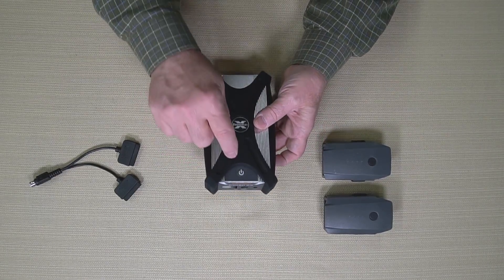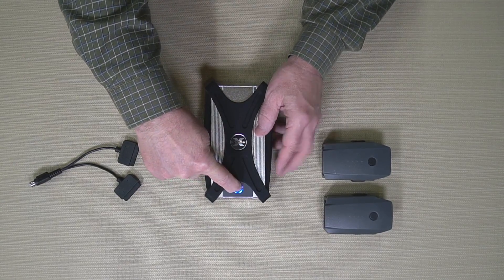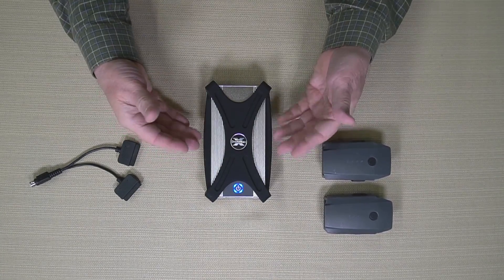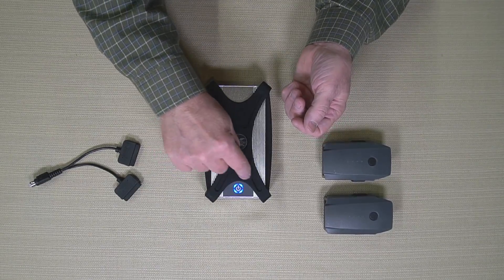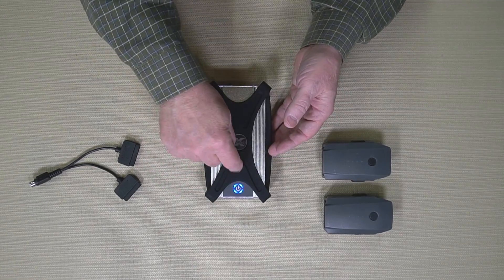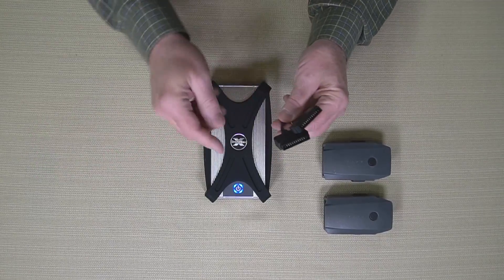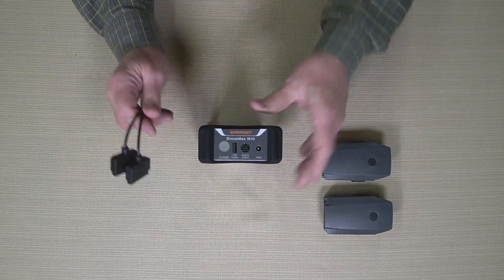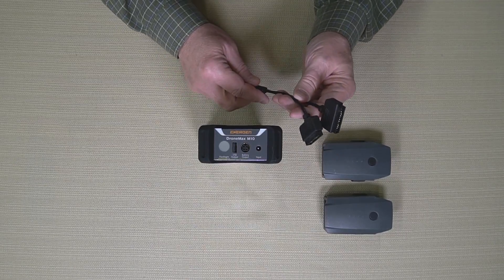To use the unit, you've got to turn it on first — just like with the Mavic batteries, you tap it once and then hold it for about three seconds. It'll go through a power cycle, doing some internal testing, and you'll see the LEDs light up — each representing 25% of internal charge. Right now this thing is fully charged. I can deliver up to six amps of current from this connector to the battery. If I'm charging one, it'll charge very quickly. If I charge two, I'm splitting that six amps between the two batteries, so it'll take a little longer.